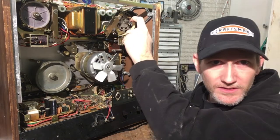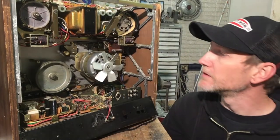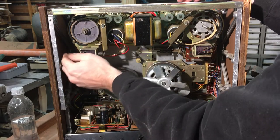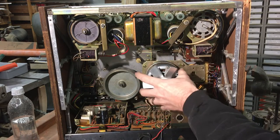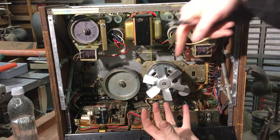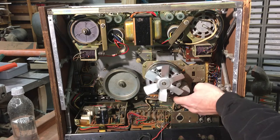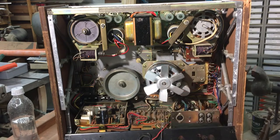But first I want to show you how I get this last motor apart. I've already done the other two, just to replace the foam and oil them up. As you saw in the time lapse, when I took this one apart I ended up pulling the entire motor out, and I had to desolder the solenoid wires because they were too short. For the bottom one: it was three screws, this whole plate comes off, then there's four screws on top that take the motor off, and then four screws to take the motor apart. A little tricky to get to — there's a couple of bendy wire clips holding wires you'll have to get out of the way, and I actually had it sitting on a bucket because the wires wouldn't bring it down to the bench.